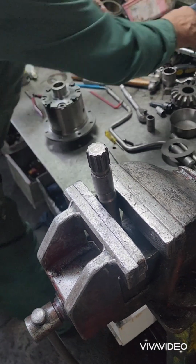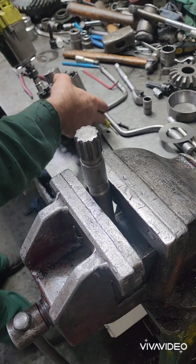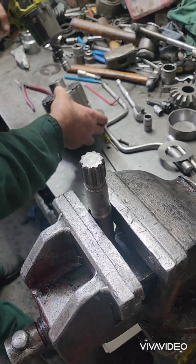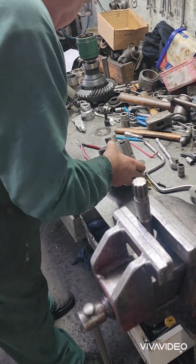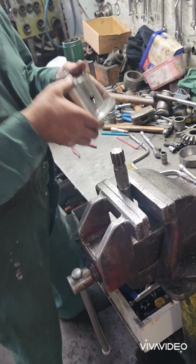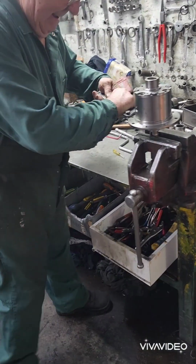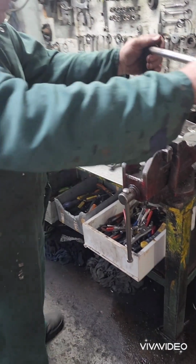So these are bolts that hold the crown wheels on the VHs that we've accumulated over the years. EH, what year would that be? Oh, they're 64s, I think. Now when we put that in there, this will rotate because I've had it together before. See that? So you know you're within 5 thou doing it this way.